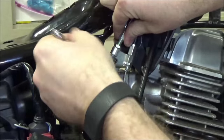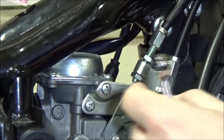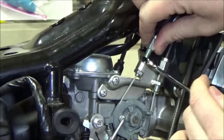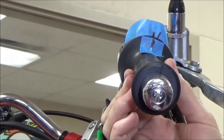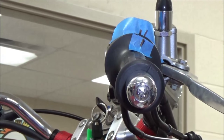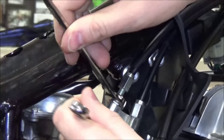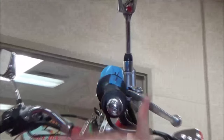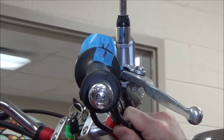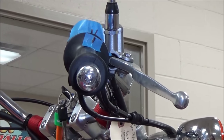Let's go into our big culprit area here. I do not want to get rid of all of the threads — I want to have a little meat left on the bone. Let's go ahead and just snug this down and check our scale up here. Looks pretty good — done and call it a day. To make sure I'm actually done, I'm going to hold this top nut and tighten these two up. We're not even talking about routing in this video, but I can't stress how important it is. So if this is where I'm at, I'm going to check it multiple times. Leave this alone, get the bike off the bench, do the lock-to-lock, find the tightest spot on the bike, and then set your free play from there.